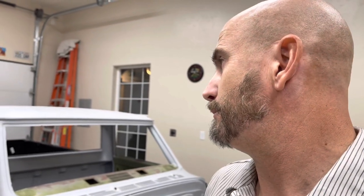From here there's a lot of other chassis assembly and stuff I have to do, but I want to get the gaps set to make sure everything fits right, because there's nothing worse than painting parts, putting them on, and realizing they don't fit. The process is basically putting the truck together not for the final time — it's back and forth. Sometimes you have to assemble and disassemble a vehicle more than once or even three times, but it's a lot better to do this initially, get everything fit, then take it apart, do all your final prep and paint. When you put it back together, you know everything's going to fit and you won't have any problems with scratching or denting panels. Gaps are looking good — time to sign off on this one. I'll come back a little bit later and do a little bit more stuff on the truck.